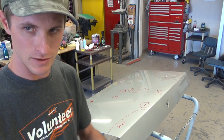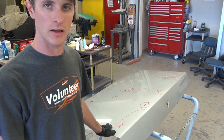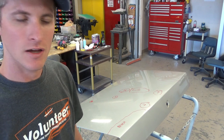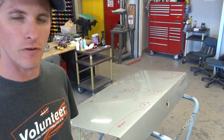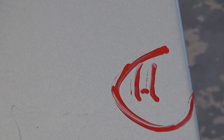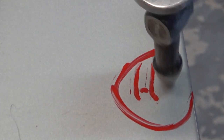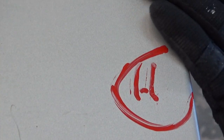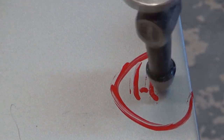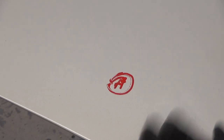Let's get started. Step one: I'm going to tap down the highs gently. I'm going to use the reflectivity of the existing paint coating to help tell me how far and where to tap down the highs. I'm using a blunt-faced hammer for that. You probably can't see it real well, but I'm looking at a high about right here. I'd prefer a small dent because we're going to grind most of this paint coating off, and that will bring our metal nice and flat.